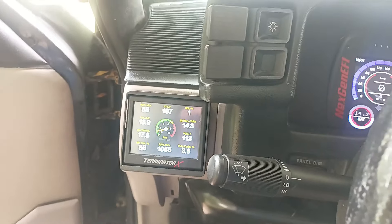If you're having issues and you order a new sensor, it'll come with this plug like the original Fox plug. There's a thing in the middle — you just take a screwdriver and pry that out, then you can pull the wires out and push them in. It's best to put the rubber grommets on first and then push it in. Don't try to put the grommets in the plug and then push the wire through — don't ask me how I know. That's it — it really wasn't supposed to be the journey it turned into, but I appreciate y'all staying and watching.